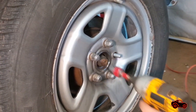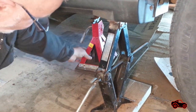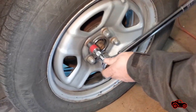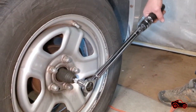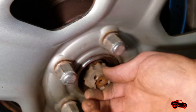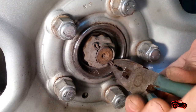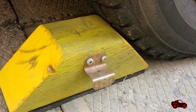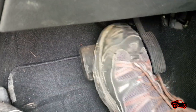The wheel was reinstalled with the five lug nuts, the jack stand and jack were removed, and the torque for the five lug nuts was set to 100 foot-pounds. With the parking brake on, the washer and the axle nut were installed and torqued to 181 foot-pounds. After that, the nut retainer, the wave washer, and the cotter pin were reinstalled. The wheel stoppers were removed and the brake pedal was depressed to bed in the brake pads before moving the vehicle.